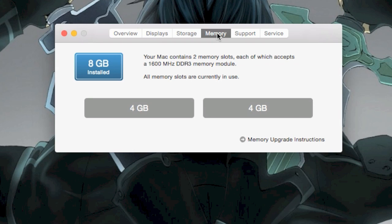A couple things you do not want to do: don't buy a single DIMM of RAM — don't just buy one 8 gigabyte stick because it will make your system run not that great at all. It's designed to use both DIMMs and it can cause error messages. Also, don't mix the size of RAM — don't use one 4 gigabyte stick and one 2 gigabyte stick. Use two of the same size: two 4 gigs, two 8 gigs, or two 2 gigs.